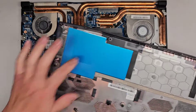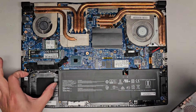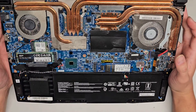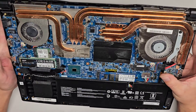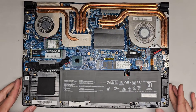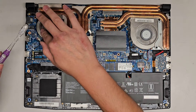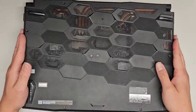There we have the bottom cover off. There's a giant metal plate there — it's blocking a two-and-a-half inch SATA hard drive connector slot. Here we have two SSDs. Apparently they put two SSDs in here. My guess is the Silicone Power one — 512 gigs — is the faulty one since it looks aftermarket. Then there's a Kingston PCIe SSD; usually Kingston SSDs are more reliable. It's super dusty in here, so I'm going to take a toothbrush and brush it while spinning it, then use an air blower. I'll be back.